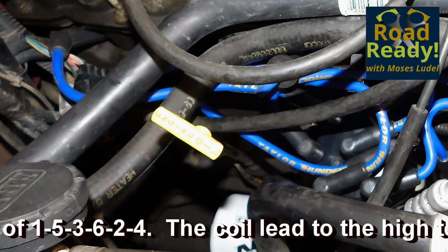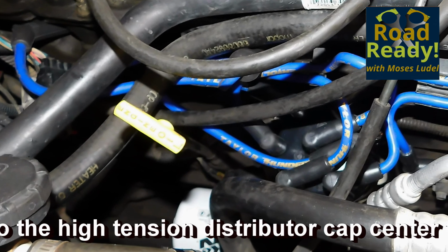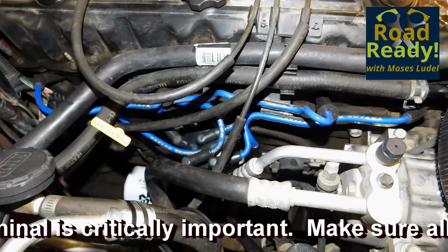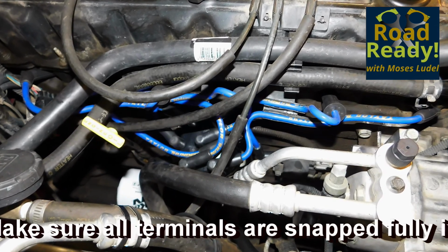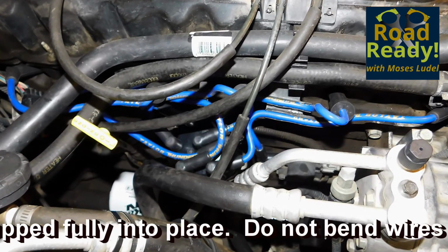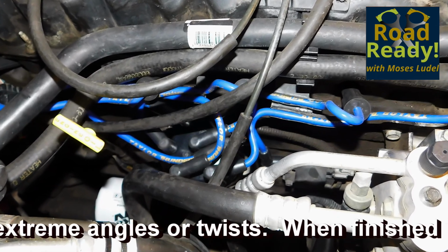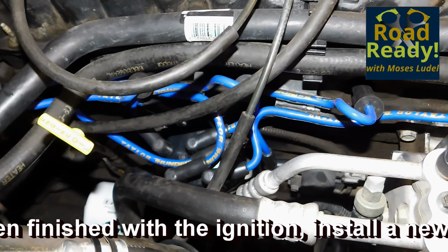As an important point, any time you do a tune-up on an EFI or electronic fuel and spark management system, be certain to clean the battery terminals and check the battery voltage. The minimal voltage for successfully running the PCM, ECM, or ECU is typically 12.5 volts. If there's too much resistance, or if the battery is defective or has a cell that's going dead, there will not be a successful tune-up. The static voltage unloaded on a fully charged 12-volt DC battery should be 12.6 to 12.9 volts, optimally 12.9.